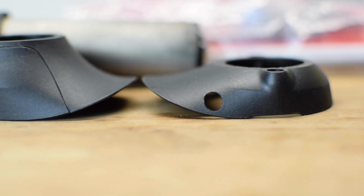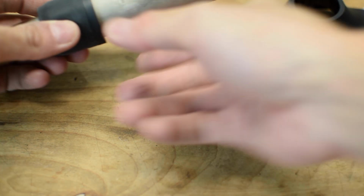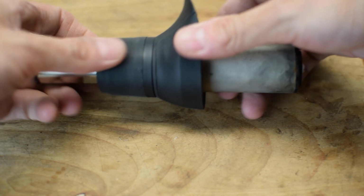Okay, so in a previous video I made on Specialized FutureShock, I alluded to this idea that there are only two nominal stem heights you can choose from, and that any fine-tuning of your handlebar height would have to be done with the rise angle of your stem. However, as one viewer clarified, you can actually get more precise adjustments in stem height by way of using headset spacers above the lower duckbill cover and below the FutureShock rubber boot. This of course requires a removal of the FutureShock cartridge, which isn't too bad, and I'll walk you through the process here. Now the thing is, Specialized uses a proprietary spacer size, so a standard 1 1/8 headset spacer won't actually fit the FutureShock cartridge.